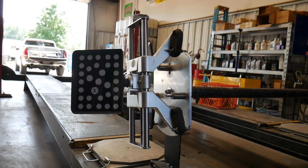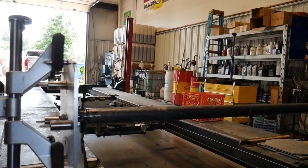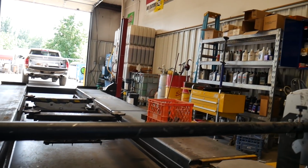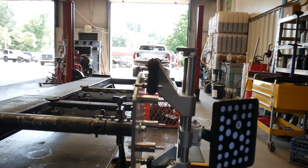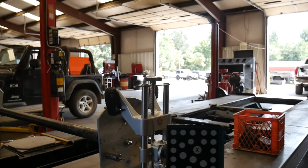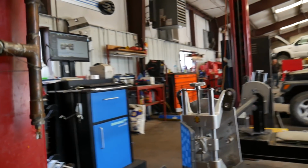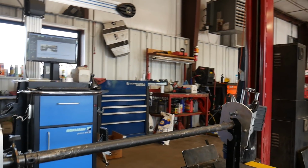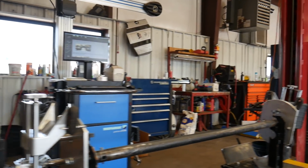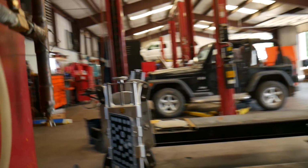The tool that the rep brought down, there's a calibration bar with a steel plate on each side for the clamp to attach to. Now there may be different plates for them to attach, whether they're using the 200 clamp versus the 400 clamp. But the bar is supposedly machined to a certain level of accuracy so that when they perform the calibration, the bar spins true and straight. The calibration does both sides at the same time. It's a solid bar, so both heads are linked together.